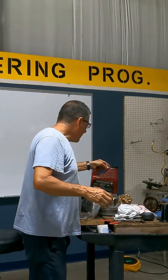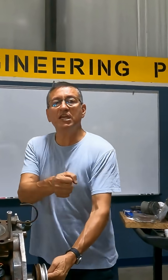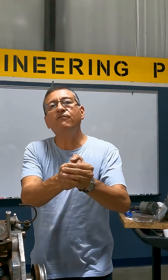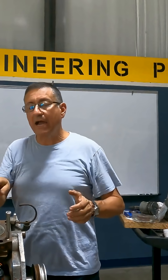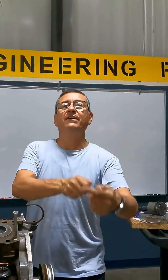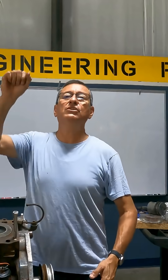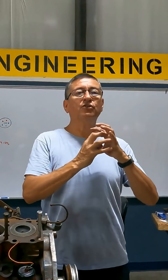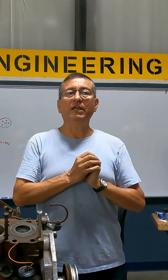The next day, I prepare a socket and a wrench, and I start to move the crankshaft back and forward, back and forward. And suddenly, the crankshaft rotates and the piston goes up and down — because the mystery oil penetrates and removes the corrosion on the walls of the cylinder.